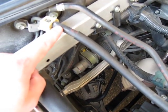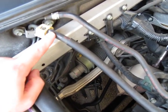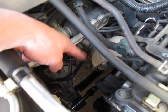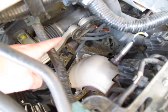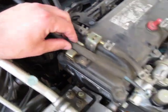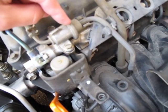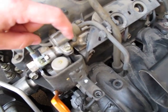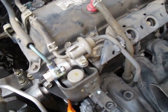If I wrap that fuel line with some insulation, that should help keep the heat in to help that fuel get hot, and that should completely vaporize my gasoline - as long as I lower the pressure. I'm going to try 1 psi and see how that does. After it's getting heated down there by wrapping the fuel line around the catalytic converter or exhaust system, it's going to come back up and connect back into this line.